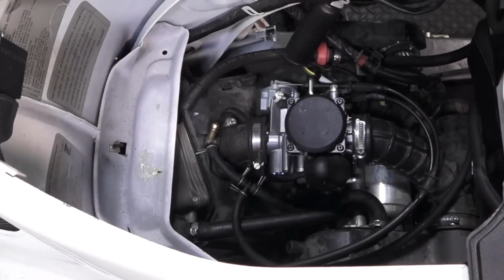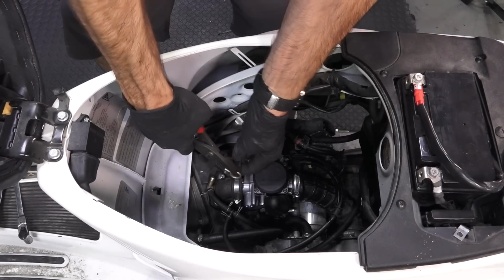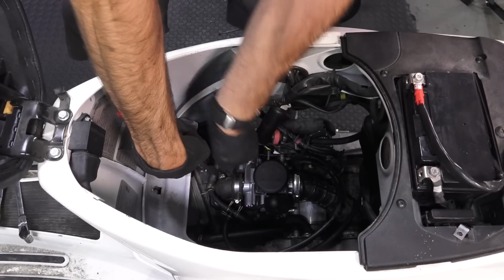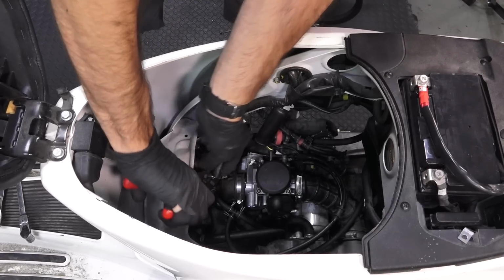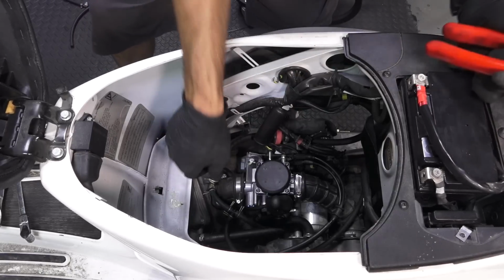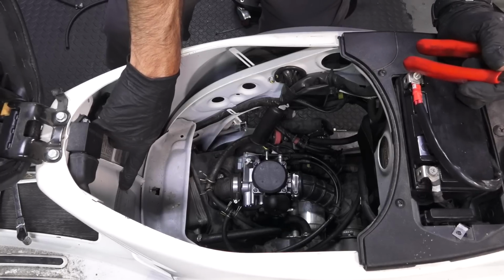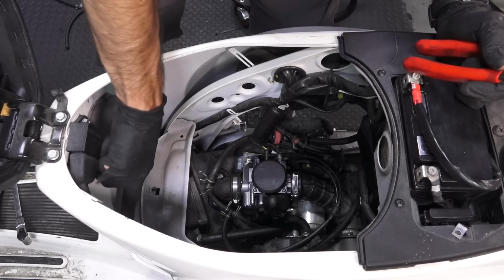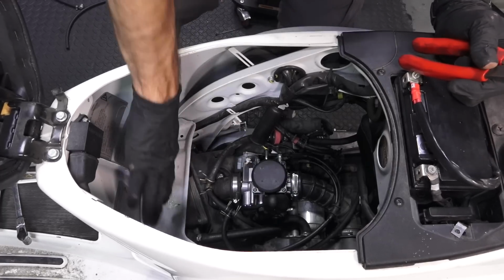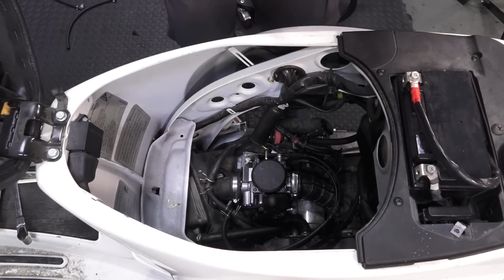So this tee is all set up, and actually before the fuel line we'll reconnect this evaporative emissions hose here. Hopefully the carbon canister isn't too flooded because some of the hoses weren't connected correctly. And if you're ever wondering what the correct hose routing is on your scooter, there is a label located right at the front of the frame that has the vacuum hose routing diagram. That's a federally mandated sticker that they do in North America. It shows you how that hose routing is.